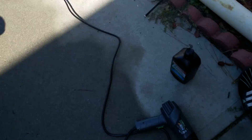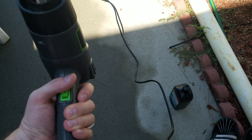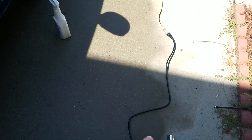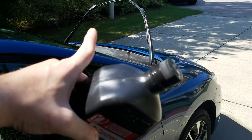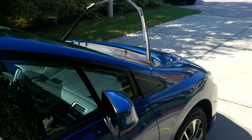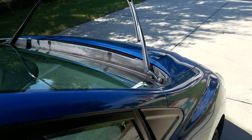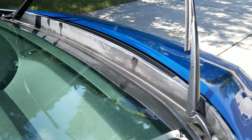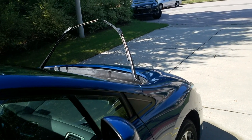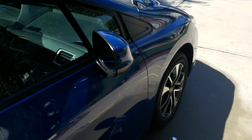I'm going to try the ultimate solution, and that is with this heat gun, which is something I've already used so I know it works. I'm going to do a mix of both methods — use the heat gun to heat along all the trim that's nasty and grody, then use automatic transmission fluid. The heat is going to bring up the natural oils that are deep below the surface.